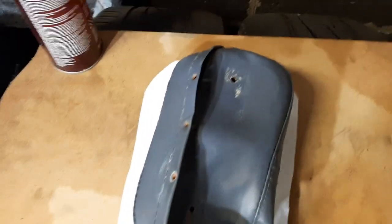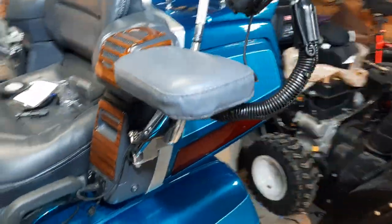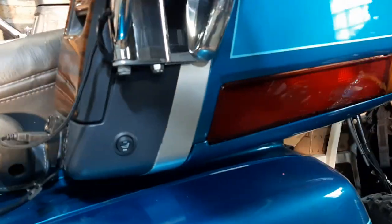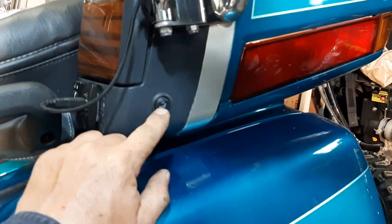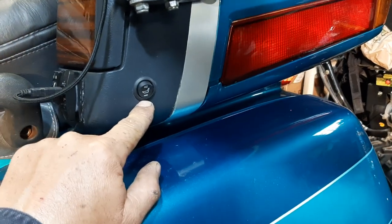Stuffed it all back into the pocket and reinstalled it — it was that simple. I had to use two kits because ATV kits are sold as singles. I'm going to try to run them from one kit at first; it's going to pull about 6 amps, so I'm hoping I'm not going to have an overheating problem with the switch. I'll keep an eye on it.